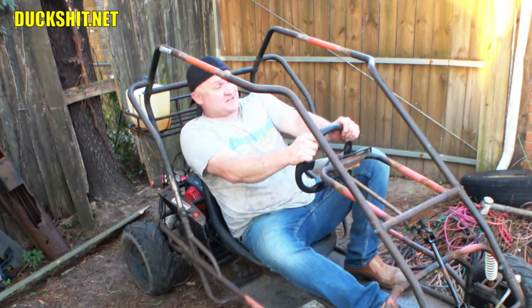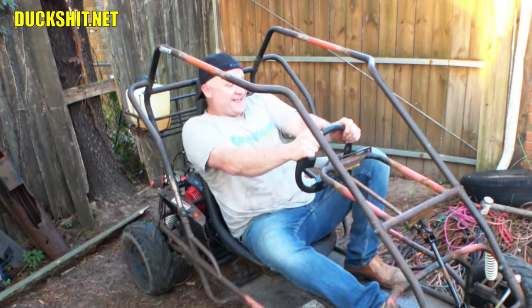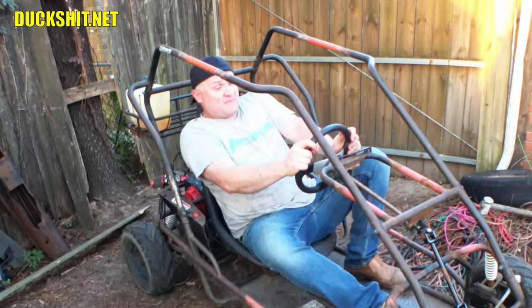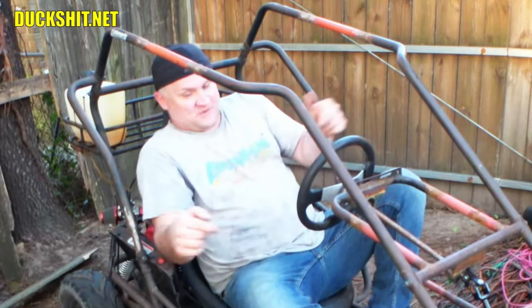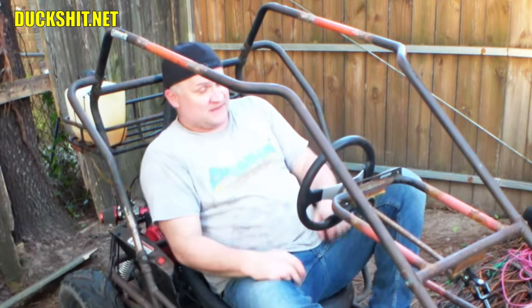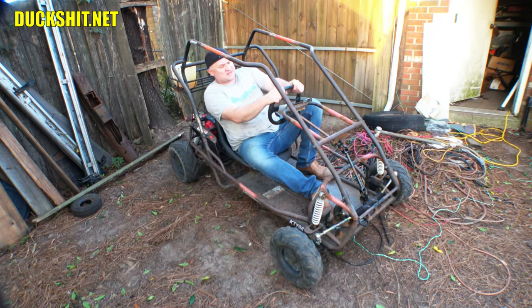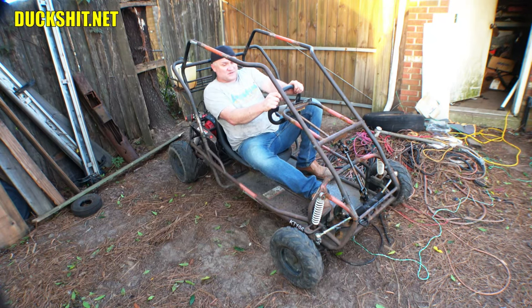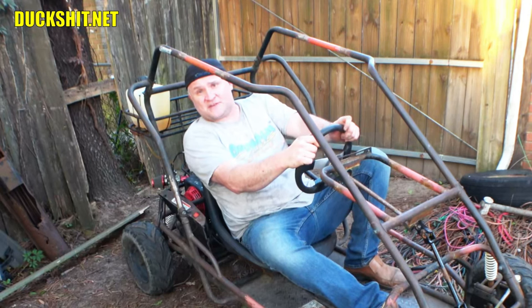Welcome back everybody to another exciting Lord Duckman production. I am Lord Duckman himself. We're back today with my KT196 go-kart, which just steers like a drunken garbage truck. It is heavy and awkward, and when it decides which wheel wants to grab, it'll slam me in either direction — sometimes you just don't expect it. On loose gravel it's not so bad because the wheels slide a little, but on pavement this thing is terrible. The steering radius is awful, the wheels fight with themselves, there's a solid rear axle in the back, and the front wheels are just not aligned properly — and it's by design. Today we're going to tear into this a little bit, make a couple of adapters, and try to get this thing to steer better. I think anything I can do to improve this is light years ahead of where it's at.